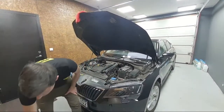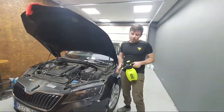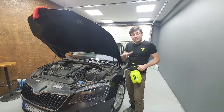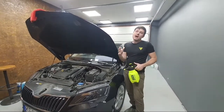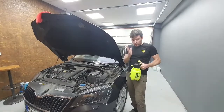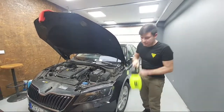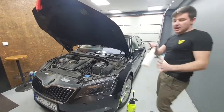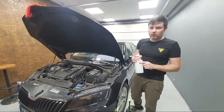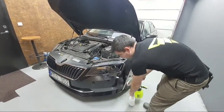Our surface is ready. Here's my slip solution. For different products I use different slip solutions, so I'll tell you what kind of mix is in there — I don't really know exactly. We'll try it: if it's going to be too much soap I will dilute it by adding more water; if it's not going to be enough soap and it won't slide, I'll add more soap in. And here's our tack solution. For tack solution I'm using isopropanol alcohol mixed with water — it's approximately 5% alcohol inside the bottle.